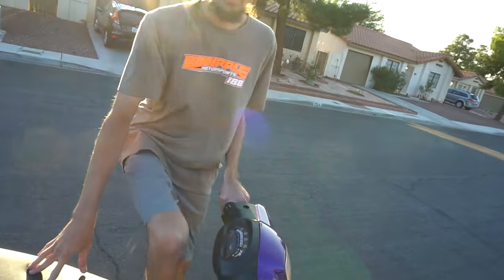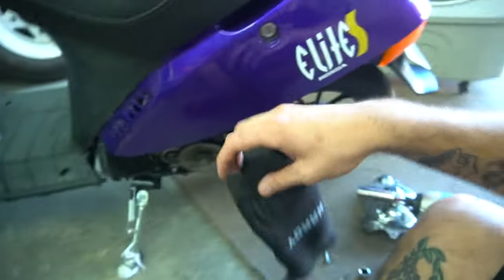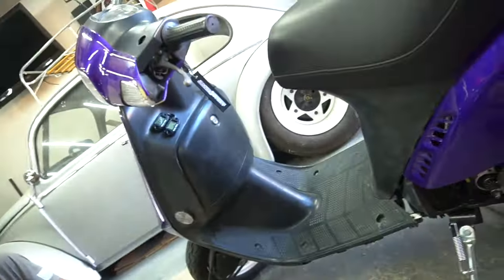What do you think about the sound? Sounds good. Yeah, I like these sounds, it will get a little louder too. Quick little roller change action. Gonna lighten up the rollers a little bit, and then we'll mob out and go tune it up a little bit. It's gonna be annoying tuning because everything's on this side of the carb.